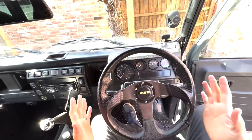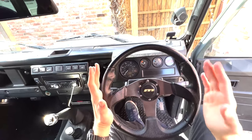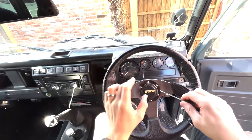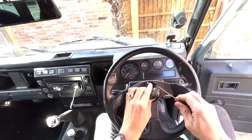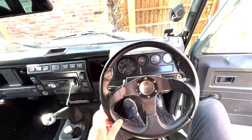This is the current setup in my car. You want to make sure that when you do this job your steering wheel is completely straight — so the wheels are straight — before taking it off. To start with you need to take the centre cap off the steering wheel, which should just pop out, and you're left there with that nut that the 22mm socket will work on.